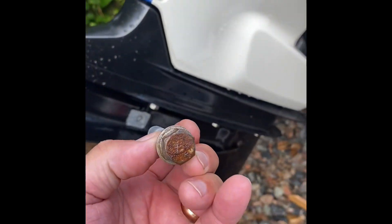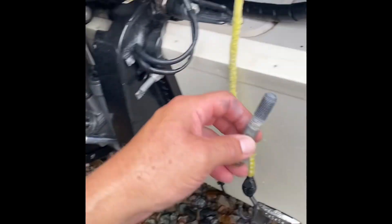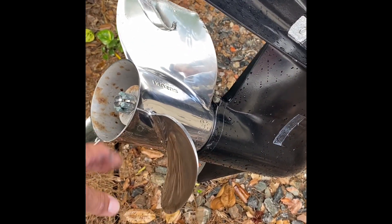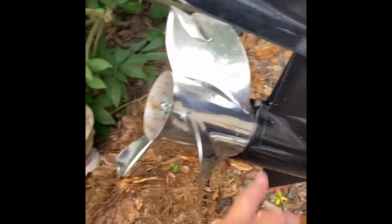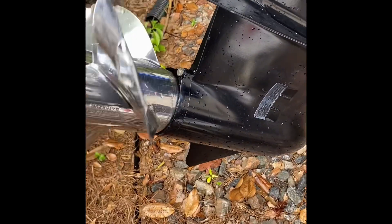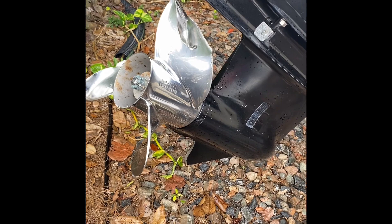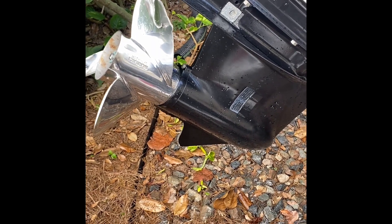Here's the bolt that's up in here — you have to take the trim tab off first, it's actually a 17-millimeter head. You do not want to forget that or you'll be very frustrated when you start taking the others loose and can't get the lower unit out. I normally take the prop off, partly to check for any line caught between the seal and the prop. It also makes the unit a lot lighter when you remove it yourself. In this case, as you can see, the shaft is warped — this is an insurance claim and I've been given approval to remove it to check for additional damage, but I don't want to disassemble anything further right now.